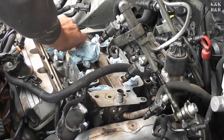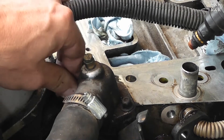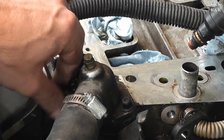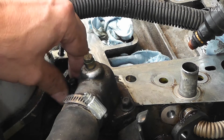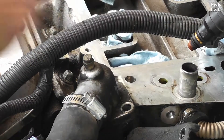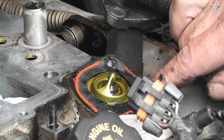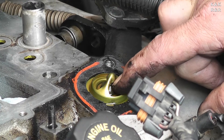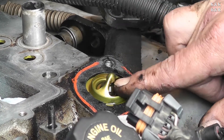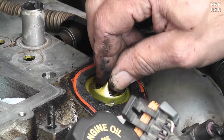At this point we're going to get the bolts off to do the intake. One last order of housekeeping is going to be the thermostat housing. A thermostat is cheap insurance — if you're going to tear a car this far down, it doesn't make sense not to do it. Now's the time; the labor's not any more. We're already there. This is an original GM thermostat, and look at that — I shouldn't be able to push in on that. So that was definitely needing to be done.